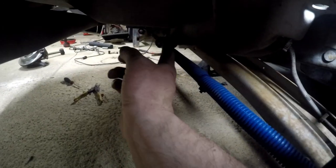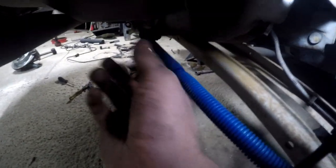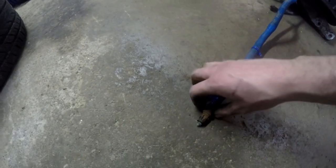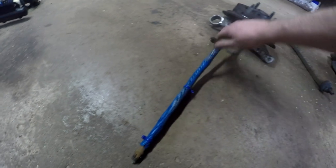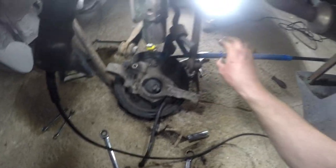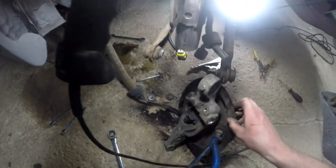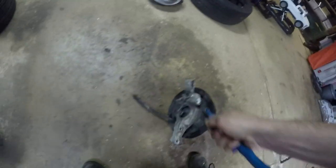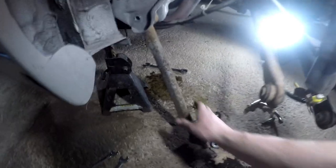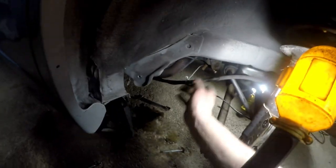This is a 12-millimeter on here — I suggest soaking it real good before you try taking it off, because you're going to use the lower line for a disc. As far as your parking brake, you just connect it in the center or just snip it and use the push tabs to pull this out. As you saw, there are tabs on here that slide into the center section — this is where you would replace this piece for the disc because this is different for the drum. Here is our drum. We're also going to replace this piece, and now time for reassembly.